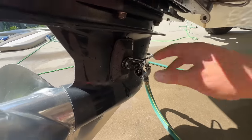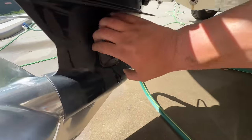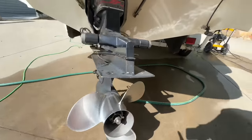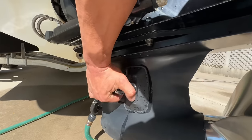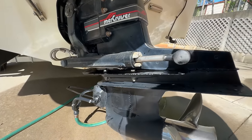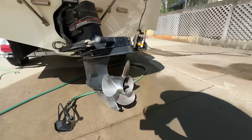I know it might seem common sense for most, but you have to have these on with the hose going to them. They're kind of hard to get off with one hand, but it lets water go in as if the boat was sucking in water. These little gills back here — see those? That's where it sucks in for the motor. So make sure you have those on if you're ever going to start like that. Make sure your prop is down but not touching the ground.